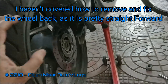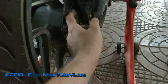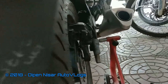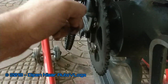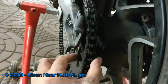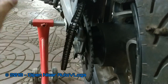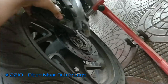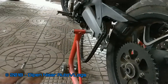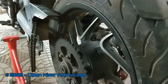My wheel is now off. This part sits in here on this notch, and the brakes fit into the disc for obvious reasons. The chain is usually on this. Once you have loosened it and pushed the tire completely inside, the chain sits like this. You can then loosen the chain and keep it aside. Take the tire and put this aside — don't stretch it much, do it very slowly. The bike needs to be on the paddock stand.